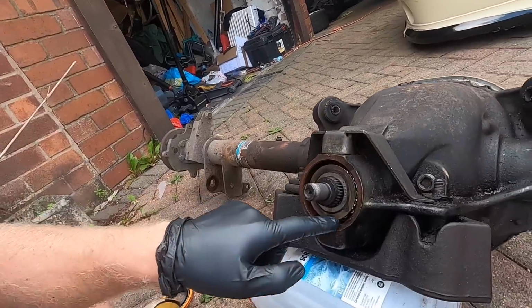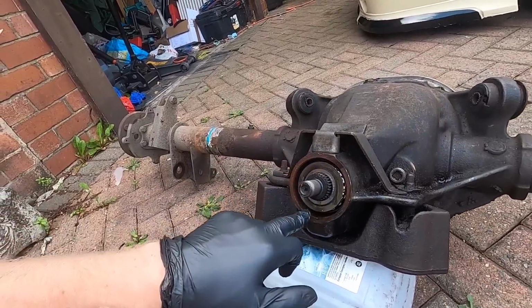So my main thing is getting to Ford show, because I am on stand with Carly and doing some promotional work with Carly, Connected Car. So I need to be on that stand, preferably with a Ford. Although we've still got the holes in the subframe, not rust holes, if you watch the last episode, you know what I mean, that's okay, I can drive on that. But I cannot drive with this oil pissing out like it was from here. So we're going to install a new pinion seal. We're going to clean this up here, and we're going to pray, fucking pray, that fixes it.